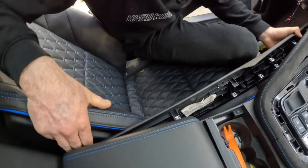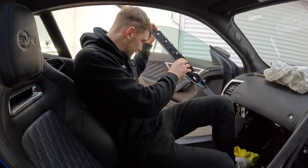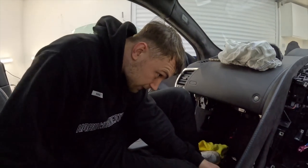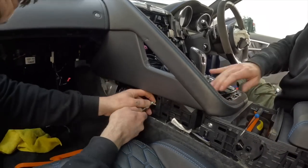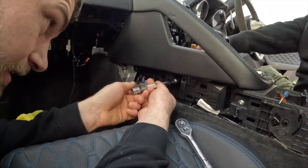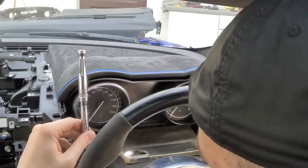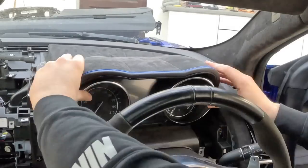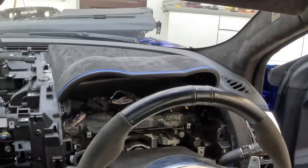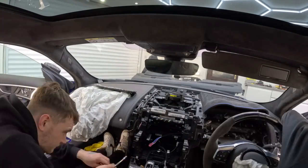The only thing holding the driver's side on was a couple of clips, so we could pull that off and then concentrate on the passenger side one, which is a bit more complicated. We were struggling with this trim for a little while, but after a bit of playing around, Liam got the hang of it — turns out you just pull it. Literally just like this. So that was an hour wasted then. Once that was off, it revealed the last six bolts to remove the gear stick trim and get to those final few bolts holding the handle in place. Then the last thing before taking the bolts out for the dash is removing the clocks — a couple of trims and one bolt hold this in, then just an electrical connector on the back. Nothing so far has been too difficult, but I'm dreading putting it back together.